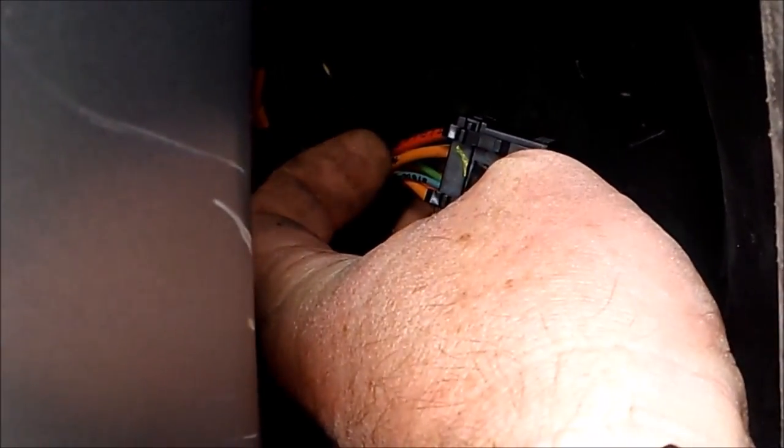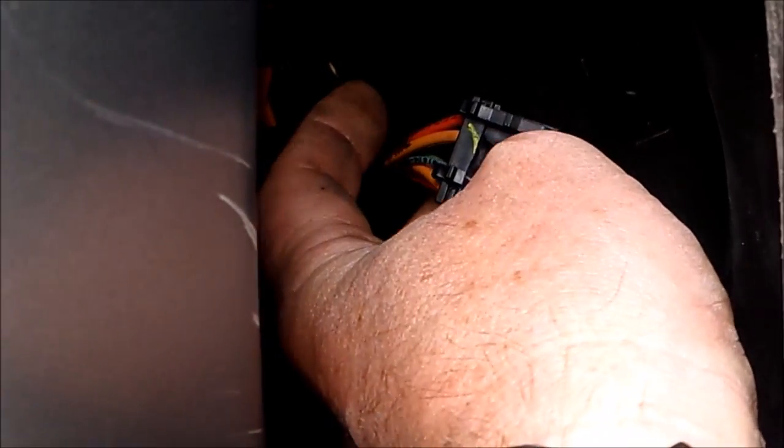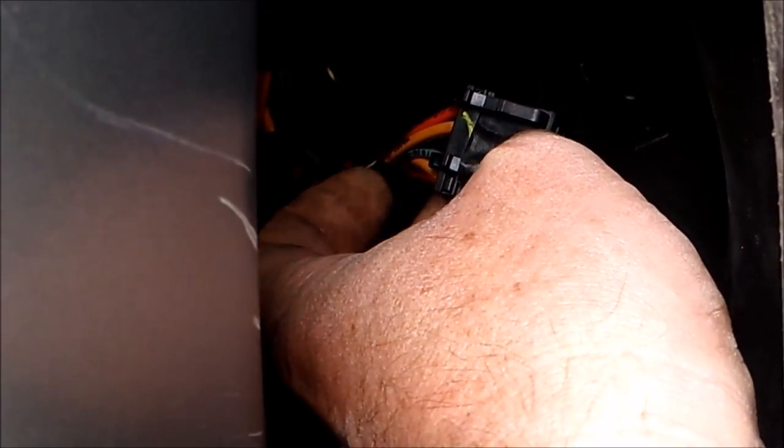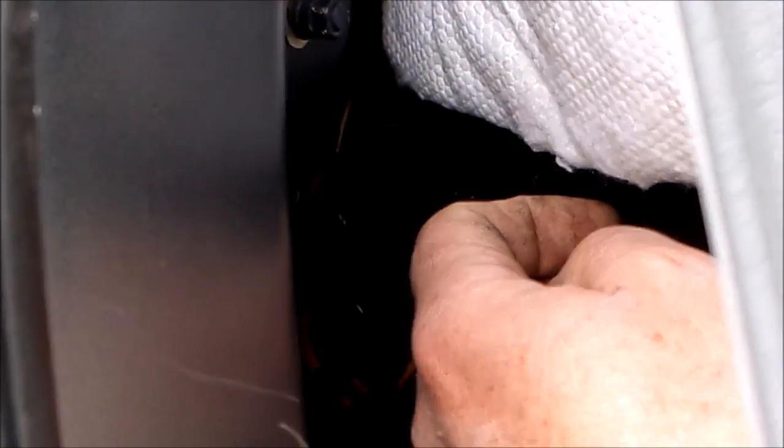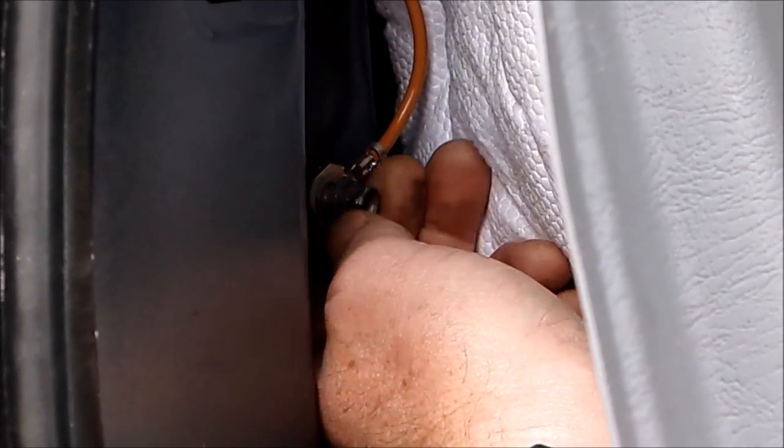See this red wire at the top — that top red wire is the positive power. Without the fuse in, there will be no power to it. The brown one, as on all Mercedes, is negative. We're going to clip these three wires. I'm not going to connect the ground through those because I'm going to ground it right here to the chassis ground — this is an 11 millimeter bolt, just take this off.